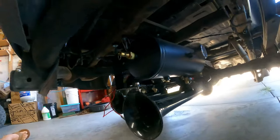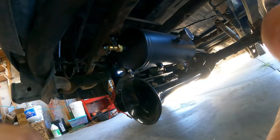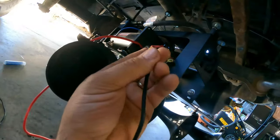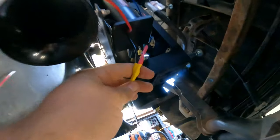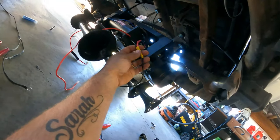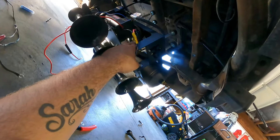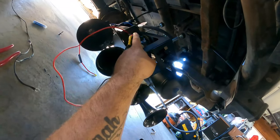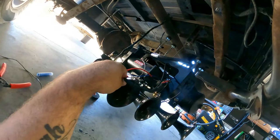Now I gotta get some soapy water and check for leaks - I just didn't have time to do all this. The garbage man's coming, gonna make a bunch of noise, so I'll cut back in a second. First off I'm gonna get this tightened down and lower this whole unit down. What I did - I combined all three grounds so now I have one strap going up there. I'm going to put some silicone around this just to make sure it's watertight and keep all the crap out so we don't get corrosion. I need to get some dielectric grease for these two plugs and I'm gonna work on getting all this stuff wrapped up and zip tied.